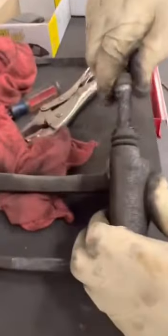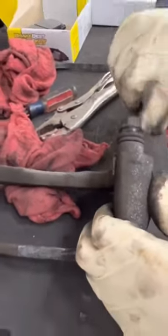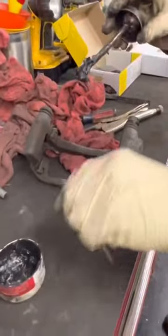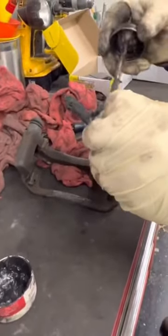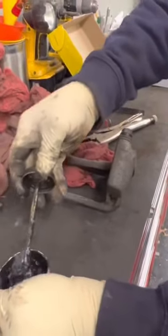Slide this one in. Now the pin's nice and easy to move. We've got this last one here to do — getting low on caliper pin lube. Let's get this one moved up, put a little blob in here.